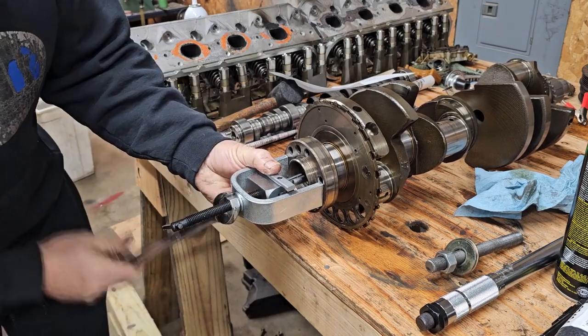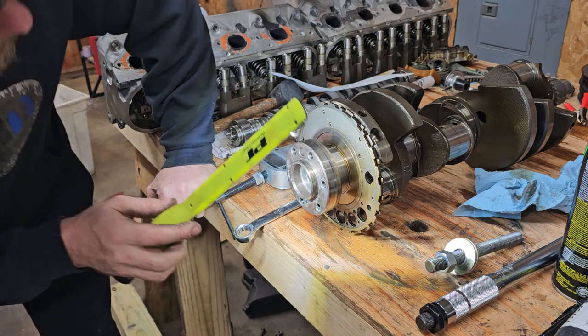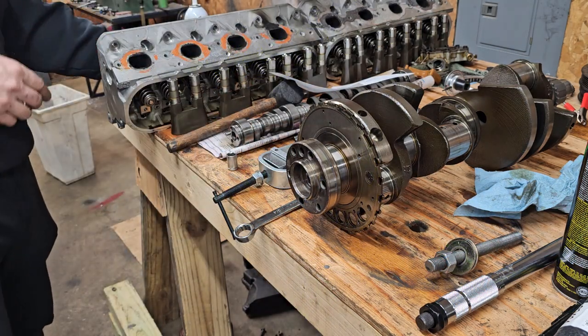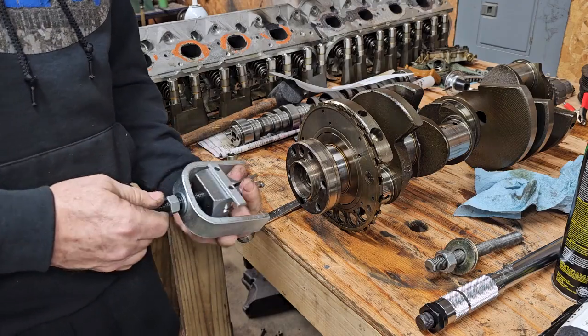And it did absolutely nothing. Pull the guts out of the bearing. Since that is a needle bearing, it tends to pull right through. Tends to flatten out the cage on the inside and pull right through. Problem I've had before with the slide hammer version.